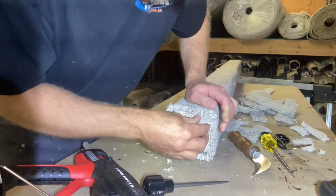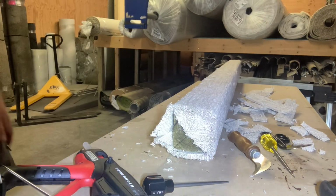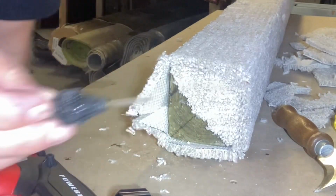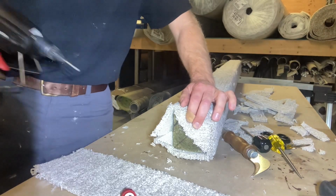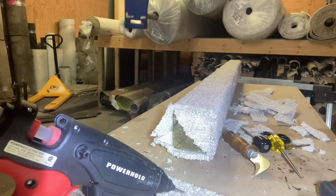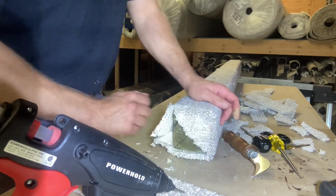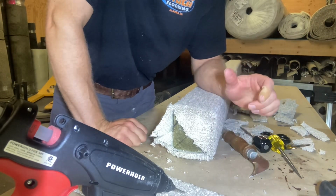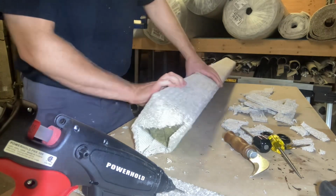And actually, what I'm gonna do, guys, I'm gonna show you this. I never showed you guys this cool little tip, but I prefer, you could use your seam sealing glue sticks, but guys, I really do prefer these extended open time ones, these ones made for putting down tack strip. I think it's just a stronger glue. Especially, I like the open working time on it. When you're doing something like this, you don't really want to be in a hurry.